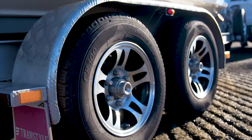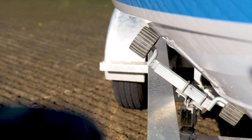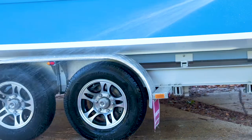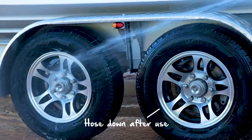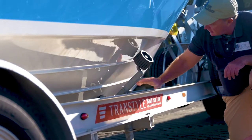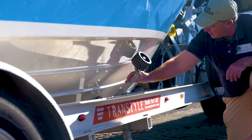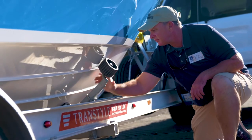How often do we see a trailer with tired tyres, broken brakes, rusty rollers, or suspension that barely keeps them in suspense? Saltwater is a natural enemy of steel trailers, so the best and easiest thing you can do is hose down your trailer after every outing to reduce corrosion. While you're washing down, check the smaller components like u-bolts, nuts and welds for any corrosion. If you see any rust, sand it with sandpaper or steel wool, then give it a touch up with rust-proof paint.